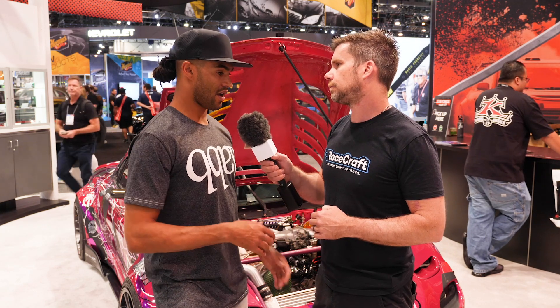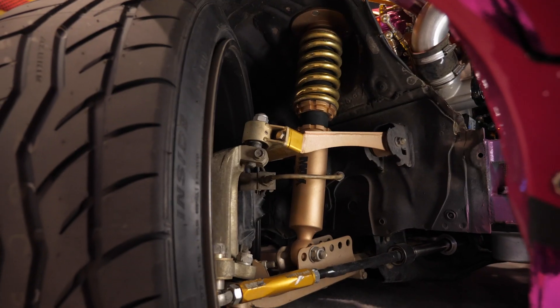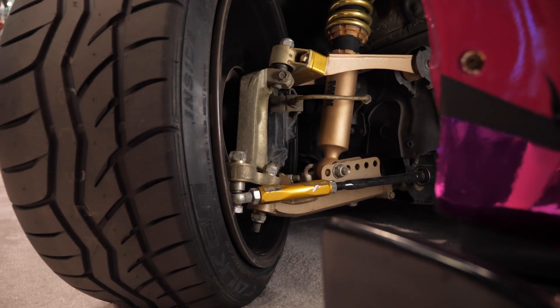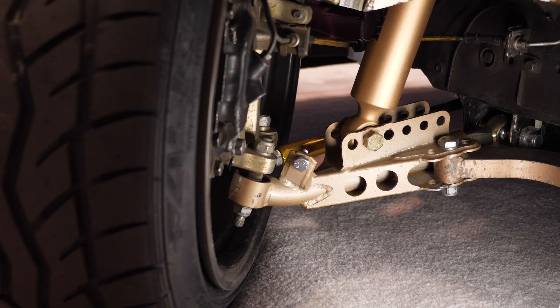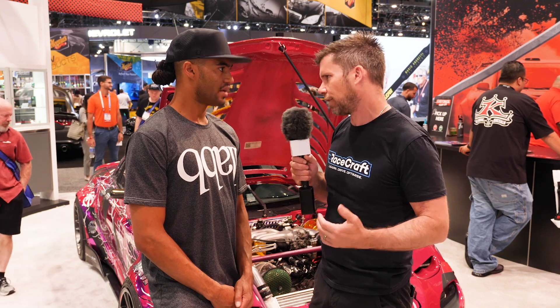In drifting you need a lot of steering lock, which most production cars don't get anywhere close to. The Part Shop Max knuckle — also referred to as the upright, the hub where the wheel bearing bolts onto — went through many prototype renditions and ended up as a fully cast knuckle with built-in trail. All Part Shop Max knuckles have the same built-in trail, making it pretty universal across their cars.